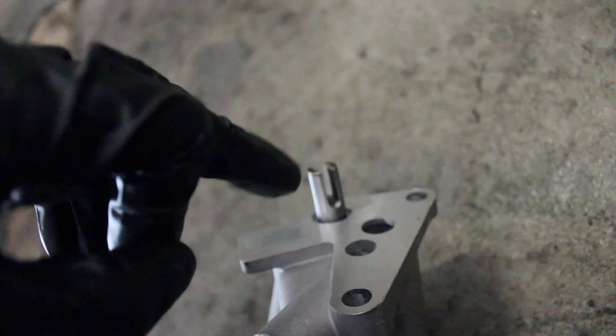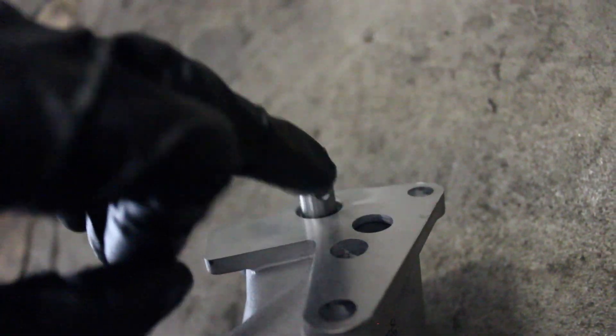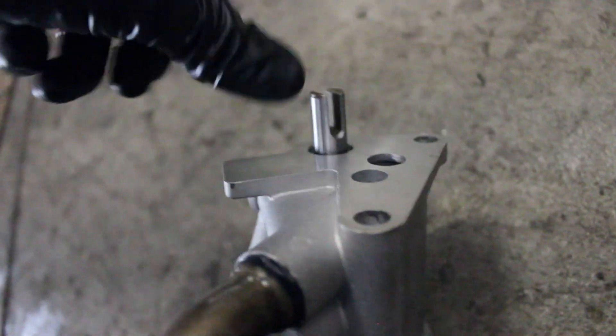Make sure you take note of the orientation of this little gear. It's got to be oriented in the same way as the one that came out so that it'll slide up in there properly. Otherwise, you'll just have to twist this around and wiggle it. I cleaned this tube out with acetone and brake clean, and got the pan and the bottom of the engine block as clean as possible.